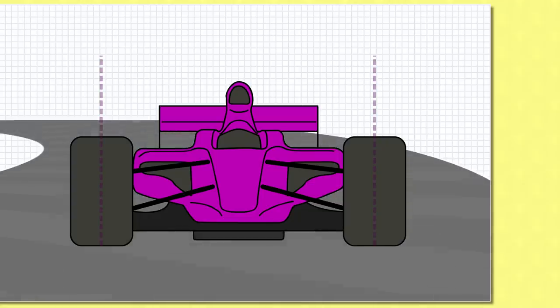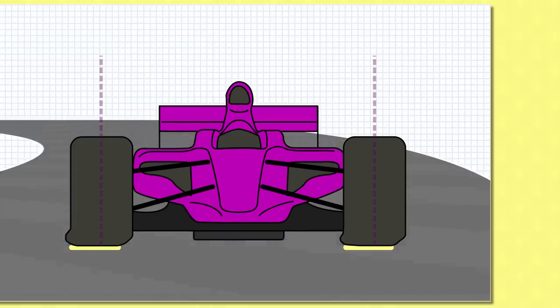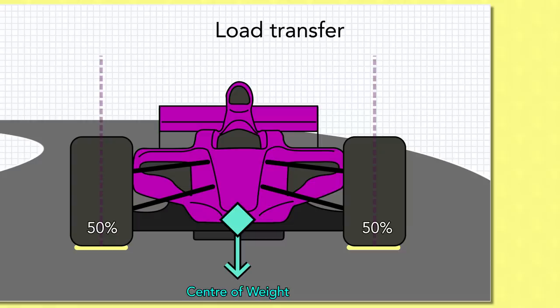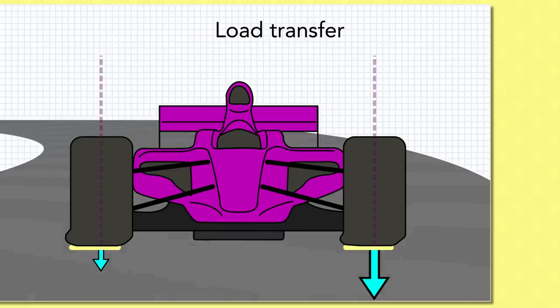When racing cars — particularly F1 cars — turn, there are very high forces involved in managing a change of direction under such high speeds. The tyre rubber, through the contact patch, is pushed laterally by the track to force the car to turn in. When a car turns in, the first thing that happens is the car experiences a load transfer towards the outside tyres. When stationary, the left and right front tyres are loaded equally, but when the car turns, the weight is thrown outwards and the outside tyres bear more of the load through the corner than the inside tyres. This means the outside tyre is critical through long, high-speed corners.